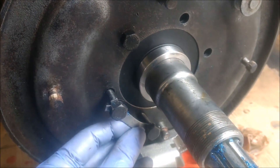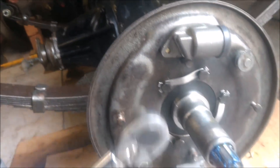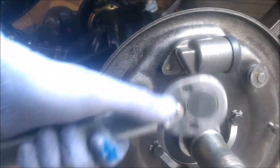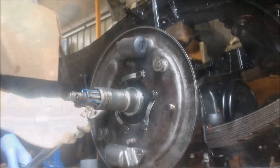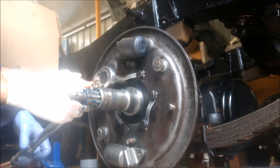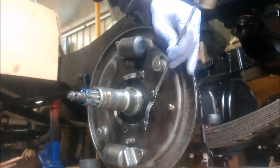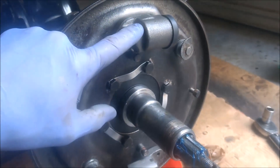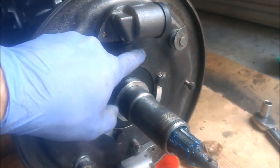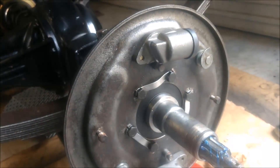These tabs are actually quite long — too long — so I've just bent them beforehand to make it easier to fit. Now I'll put them on here; there are six of them all up. They're in position now and all I'm going to do is torque them up to roughly the right torque settings on each. The tabs are all bent back now. It would be a lot easier if you did it without the cylinders in place, just to get to the ones that are in the way of the cylinder — it's doable, but a lot easier without those in the way. Anyway, it's done.